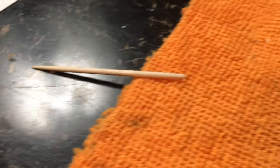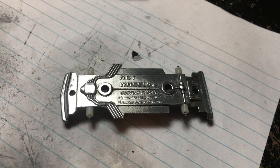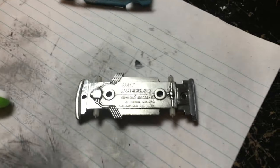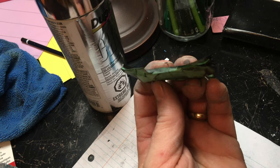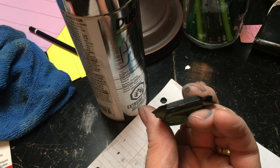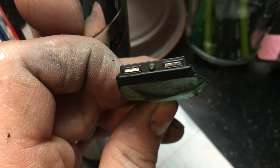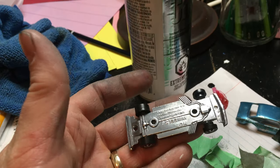I used a combination of toothbrush, microfiber rag, and toothpick. Now I'm going to work Mother's Mag aluminum polish on the chassis to get it a little bit cleaner. The chassis is now polished using Mother's Mag aluminum polish with the combination of a toothbrush and microfiber rag — it looks really good. I've masked the floor pan off, painted the tail panel and the grill with Tremclad semi-gloss black, scratched the taillights off, and painted some insignia red on there. Tail lights are done, the rear gas cap is cleaned, and it's time to put the wheels on.